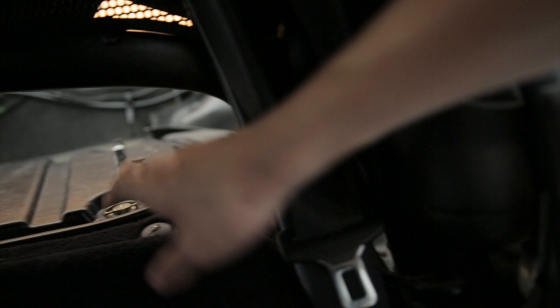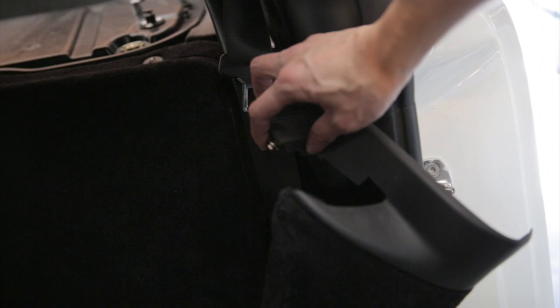For over here, the bolt is a little funny. The top bolt holding this piece was right here. I needed to remove the little piece of the engine over here and access it from here, or else the little fabric piece gets in the way. So one bolt is right here. Don't remove this all the way or else it'll fall off — just loosen it, because there's a weird position where it might fall in somewhere.